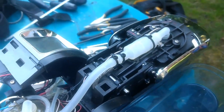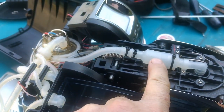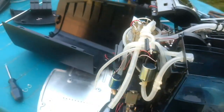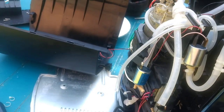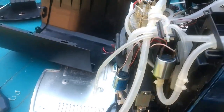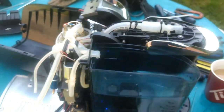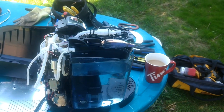One thing I did initially, because I thought it was acting up, was take the one-way check valve out. I don't believe that was a problem now. When I get the solenoid from the other Keurig, if it's the same type, I'll put it in, test it, and put the check valve back in. We'll do another video and I'm going to put all three videos together.